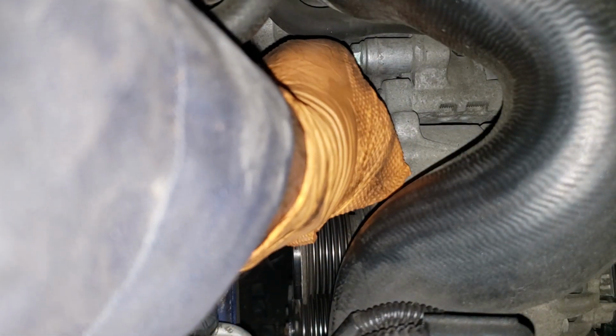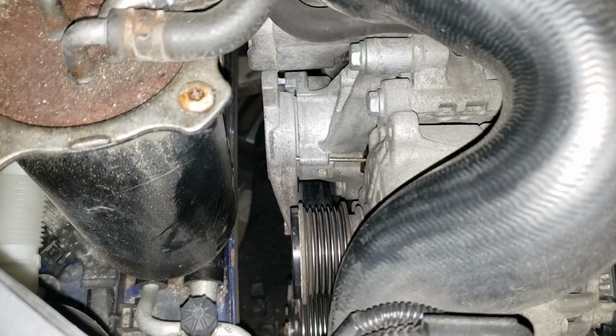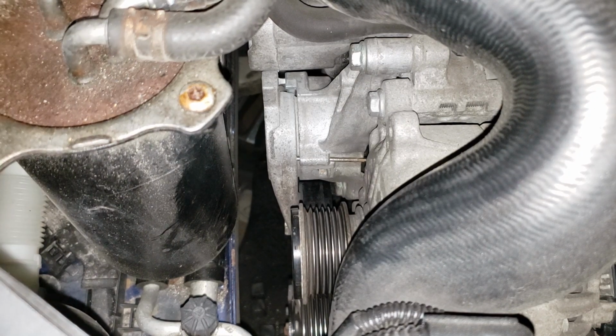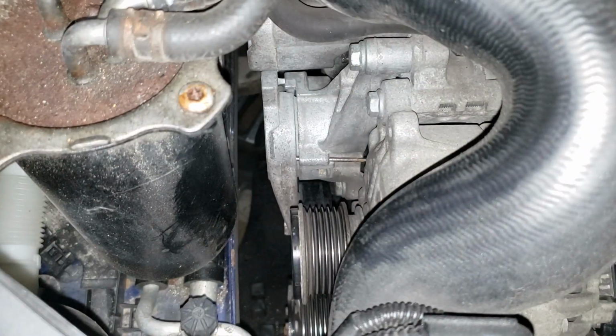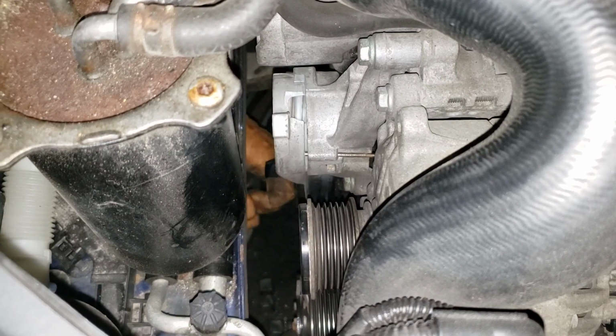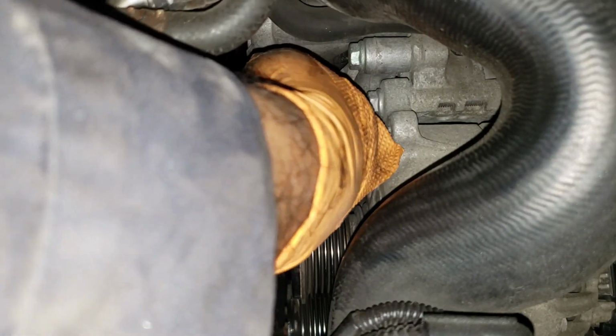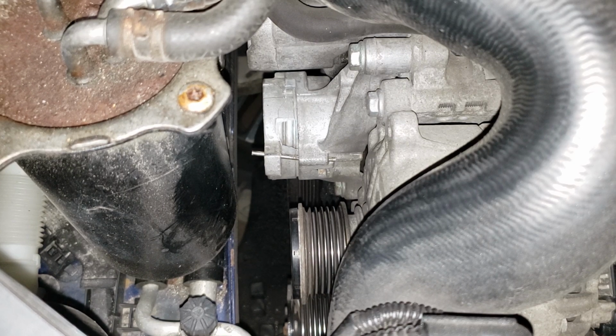Okay, so this is basically all you need. It's just a small either dowel or punch that is busted. You're gonna slide it in to the back of this thing here, and you'll see it protrude just a bit, right? Now, what you gotta do is get that guy all the way over. So get that 16 mil wrench, twist it over, and then slide that dowel through the little tab that's on the front here. Well, you can't really see it much. Well, you can on camera, but I can't see it. You're gonna slide it through this guy here. Now, I can't see what I'm doing, but I'm gonna slide it through. You gotta slide it through like that, and now the tensioner is locked in place, and we can access the 13 mil comfortably from either the top or bottom.